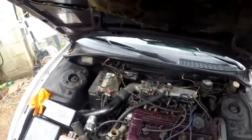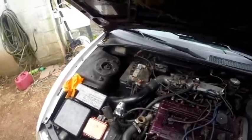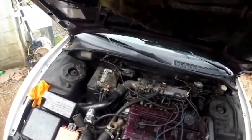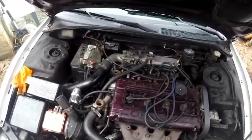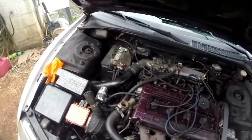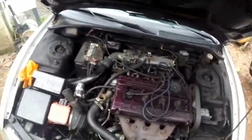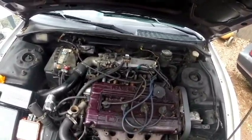And when I put it in there, it wouldn't start because the firing order was wrong. I did some research, and the firing order on a 97 is just a little bit different than a 99. I did the 97 firing order. It worked. And then a week or two later, it stopped starting and stopped running. So I put it back to a 99 firing order, which then it started running, which I don't understand why it did that. But it's running, so that's all that really matters to me.